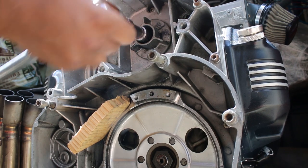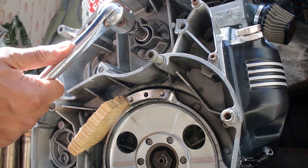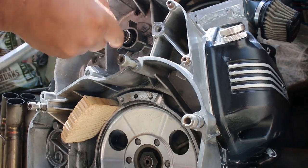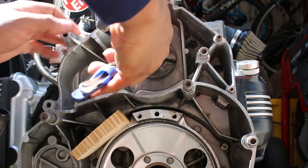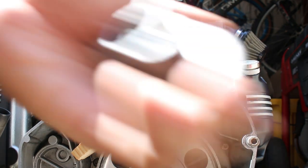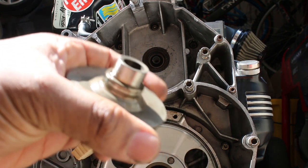This is the position you use if you want to loosen either the clutch carrier nut or the alternator drive dog. Sometimes the alternator dog is seized in there so tight that you might have to use a bearing puller. Other times it's so loose you could just use your fingers. Mine was the middle ground where all I needed was vice grips. But then something strange happened. As I was turning the gear that the starter engages on through that small opening, I was using my finger and realizing that it was finally engaging with the crankshaft.